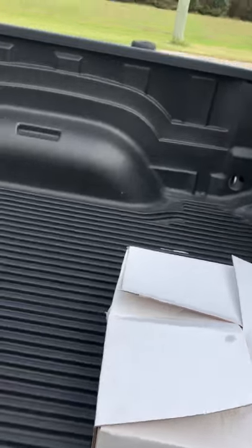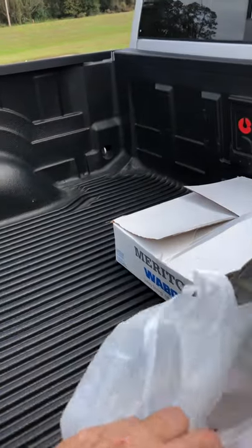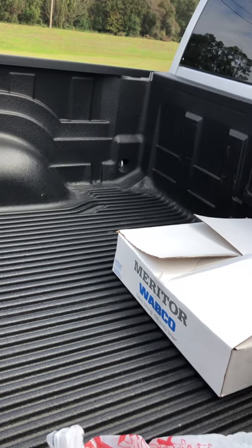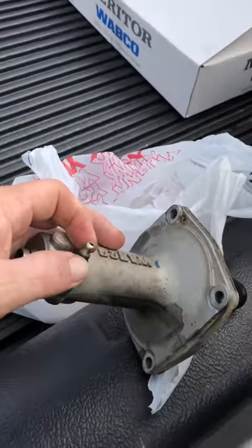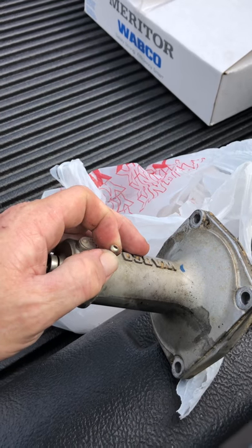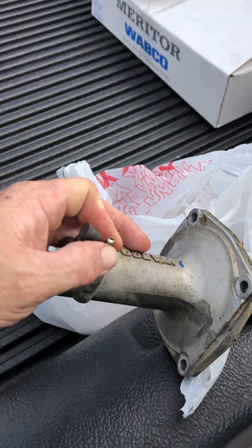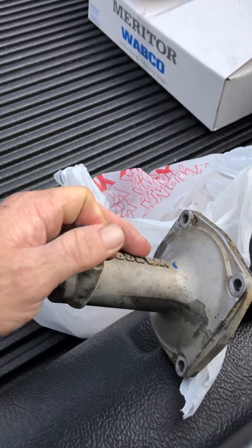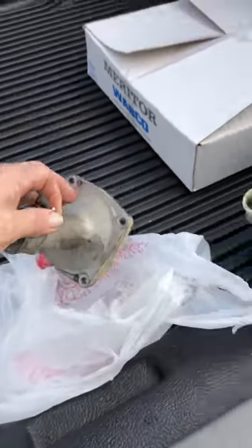When you're laying under there, you have your wrench on the slave cylinder bleeder bolt and you crack it loose until you see brake fluid coming out. Then you tell your helper to put some air in — put some pressure in it — and you force the brake fluid and air bubbles down. You'll see air shoot out of this. Don't open it wide open — just open it enough to control the flow. When all the air is out and it's good and clear, tighten it up and remove the air.